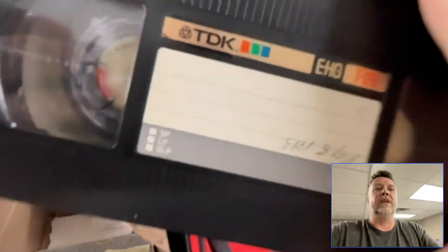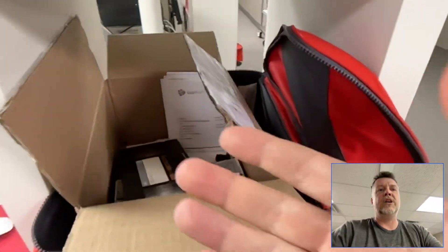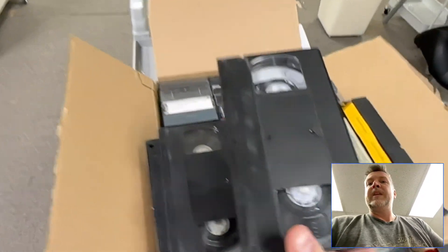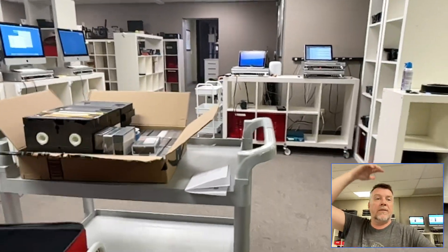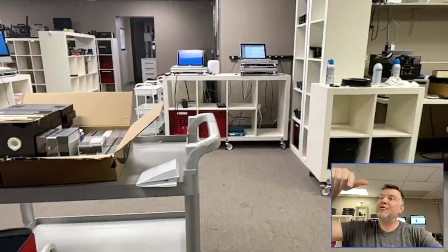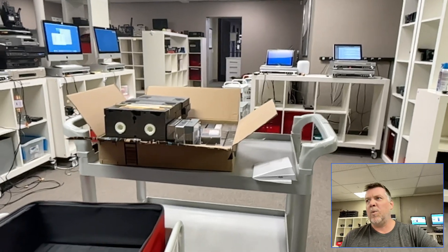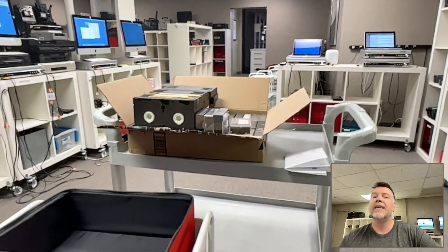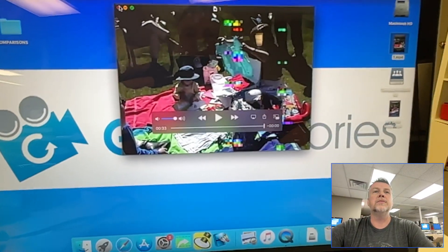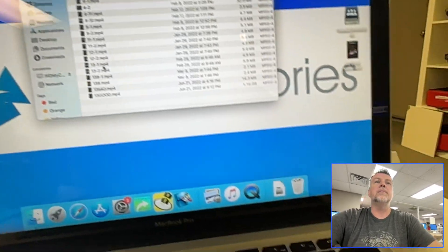Here's a lovely specimen — look at this mold right here. All these tapes are moldy with issues because they have not been stored correctly — humid conditions, moisture. That is where you see a lot of people's videotapes looking like crap. And before your clean tapes go in, if a previous customer's moldy tapes weren't cleaned, your stuff goes in and it all looks like crap too. Then these companies put stickers on your tapes saying your tapes are bad, when it's actually the player that's clogged with mold and crap.